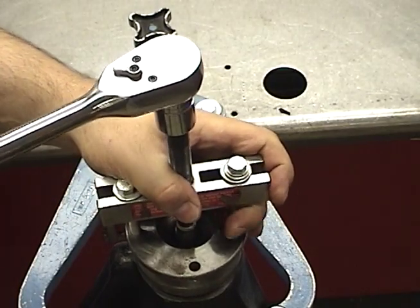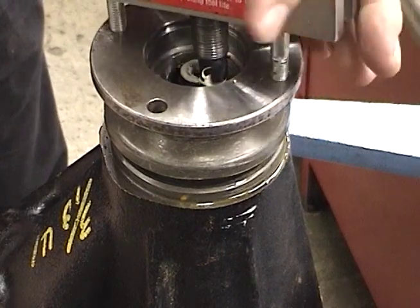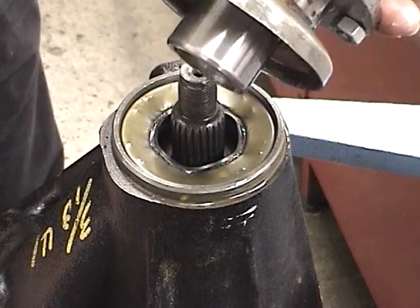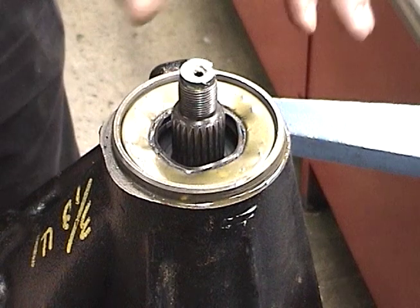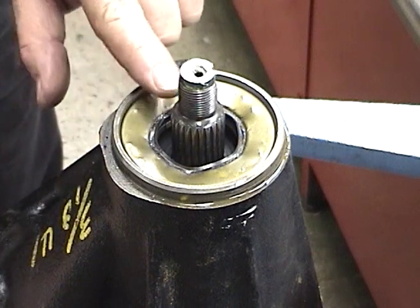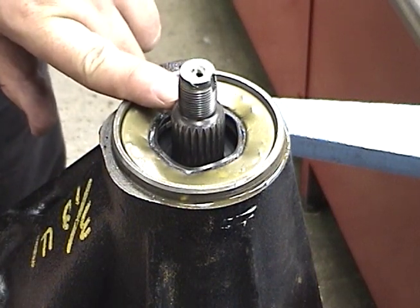In this case, it's already pretty loose. And there's your flange. Before you pull your flange off, you should hang on to your pinion, because sometimes the pinion will drop — and if you're going to use your pinion again, you don't want it hitting the ground and getting damaged.